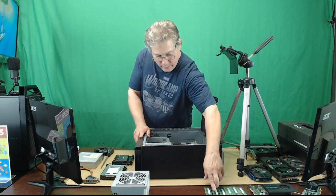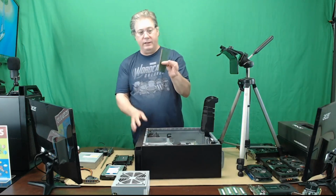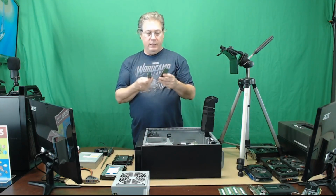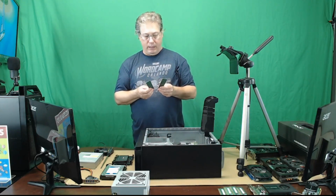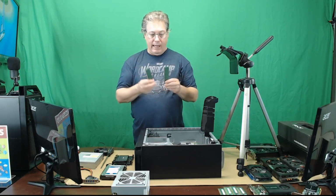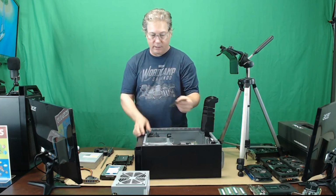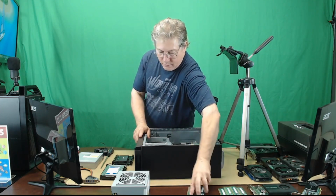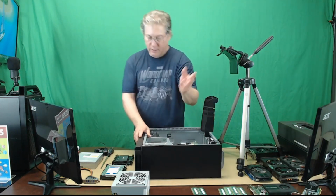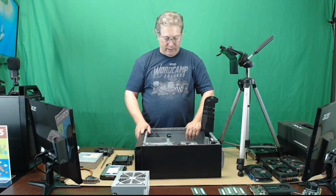And the good thing is that if you replaced 2 of these in the future, it would only cost you about 20 bucks. And if you replace them with 4 gigabyte modules, now you have 8 plus 8, you're up to 16, and you can do anything with 16, short of heavy video editing and things like that.